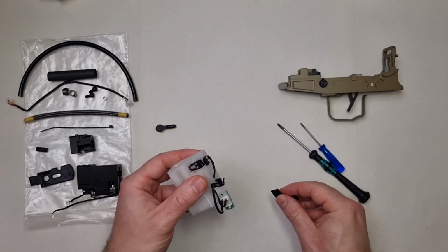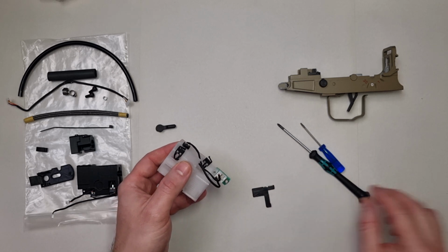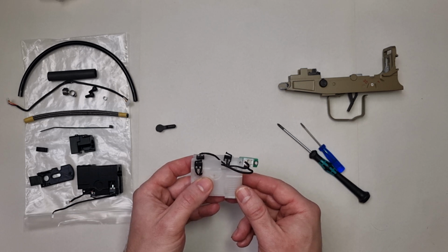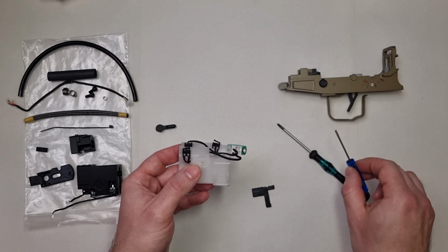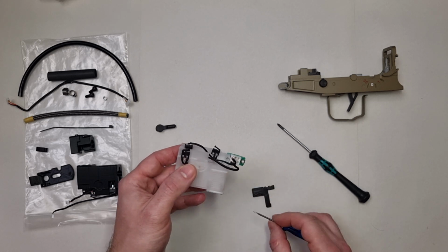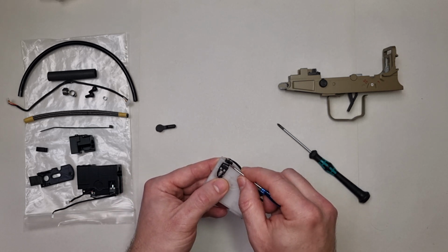Now double check if it preserved its position. In this case, it does. If not, try to readjust it again. If you could not find such a position where the switch toggles without resistance, try to reduce the entering edge by shifting the switch to create a little tilt, like that, or by rounding down its lever entering edge with a sharp blade or a file. This one.